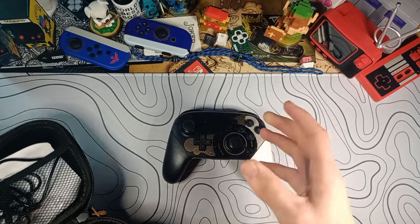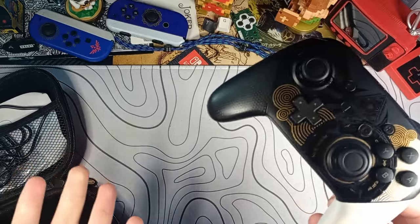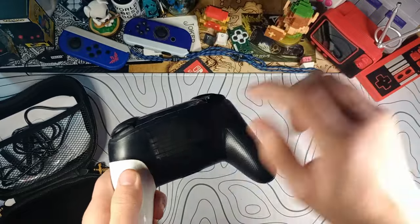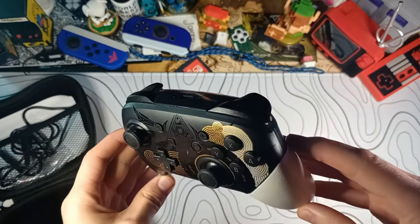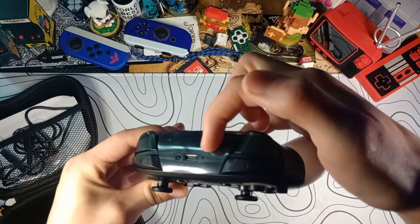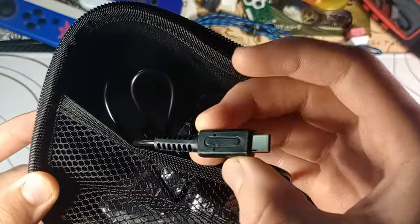So this is the clone, fake knockoff version of the Tears of the Kingdom pro controller. These controllers pretty much use all the same internals, of course cheaper versions, but they're almost one-for-one to the original controllers. They even use the same battery as the original pro controller, which is a 3DS battery — you can pop it out and put another one in very easily. And because this is so close to a Nintendo original pro controller, all the different shells and modifications work. Up top there's the charging port, sync button, and charging LED, just like the real one, along with a USB Type-C charging cable.